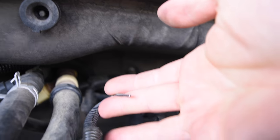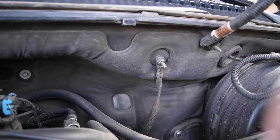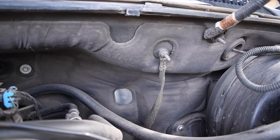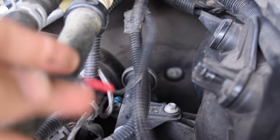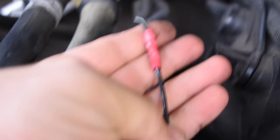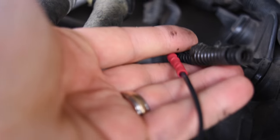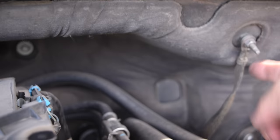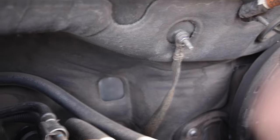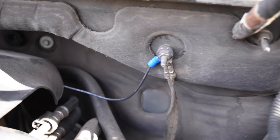I'm not sure exactly why it goes from that harness and relates to those other systems, but I went ahead and regrounded it — whether that's a chassis or body ground. I used a small butt connector and put a new piece of 16-gauge stranded wire on there, tucked it all back into the casing, taped and sealed it shut, then ran it behind where the manifold plastic cover would be.